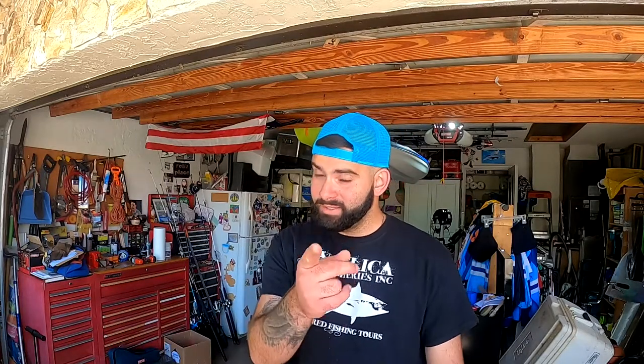And most of you guys are like, well, how'd the gas tank just randomly get a hole in it if it was just refinished? So basically what happens, I actually just learned this. I'm actually in boat mechanic school right now. So if you put garbage fuel in it, like something that isn't just straight gasoline, the gas is gonna absorb moisture, and moisture from the water will corrode out an aluminum tank, therefore creating a hole in it, and gas comes pouring out, just like what happened.